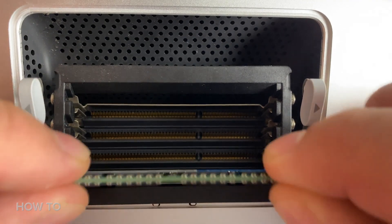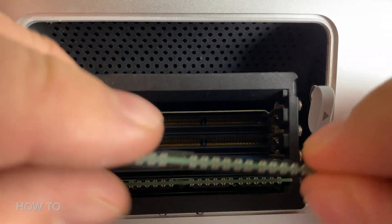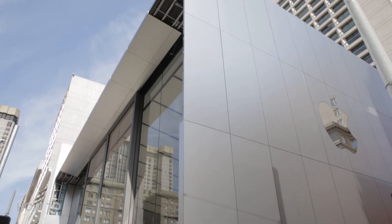Let's talk troubleshooting. Depending on how old your iMac is, you might hear a tone when you first restart it after installing RAM. If your iMac is from before 2017, you might hear a beep that repeats every five seconds — that just means the computer can't find the RAM. The easiest fix is to shut it down, unplug it, and reseat those RAM modules, making sure you hear and feel that click. If you hear three successive beeps spaced five seconds apart, that means your RAM didn't pass a data integrity test. First, double-check that the RAM you bought is correct for your iMac. If it is, turn the computer off and reseat the RAM, making sure it's in there nice and good. And if that doesn't work, it's time to go to the Genius Bar.